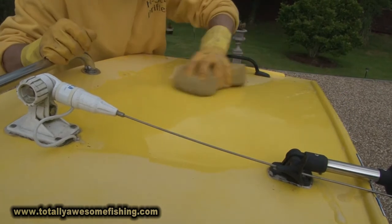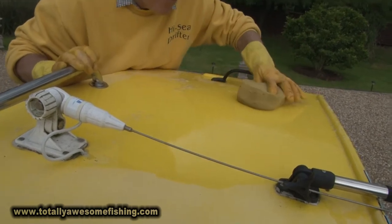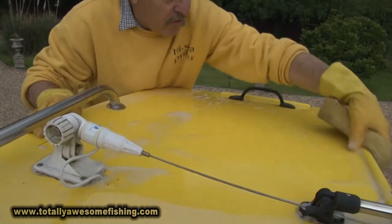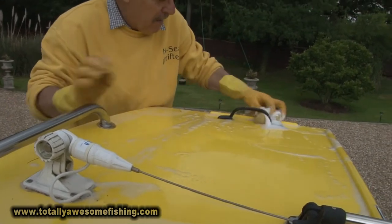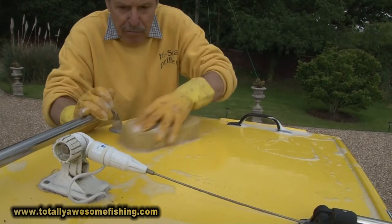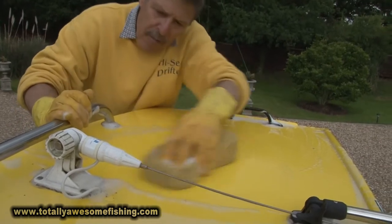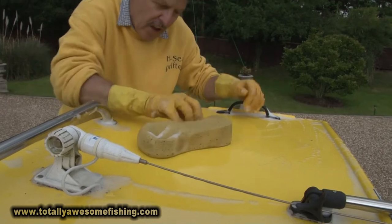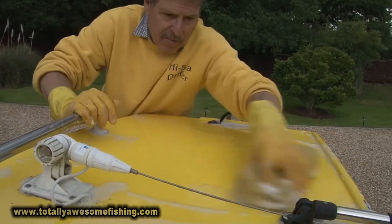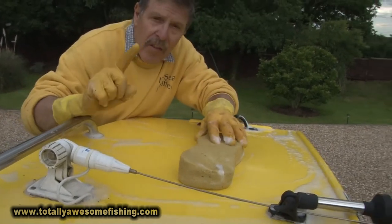With this marine wash, just use a sponge and gently rinse it all over. On a sunny day you need to do smaller areas because you don't want it drying out. Let it sit on there for about two to three minutes — I'm going to show you the difference on the two halves of the boat. It breaks down all the grime and muck and draws that color back out. I'm not scouring — you don't want to scour because you'll scratch the surface. Leave this two to three minutes and then we're going to rinse it off.